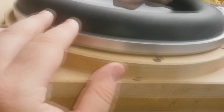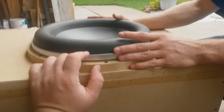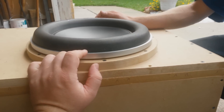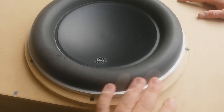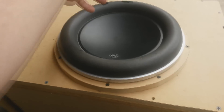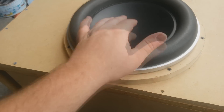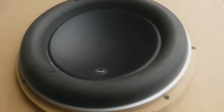It takes 12 screws to screw that thing down. For future reference, if anybody ever needs to know how to take apart a JL Audio subwoofer — you take this metal ring off by prying it apart with a screwdriver. There's a little gap right here that you pop off with a flathead. That takes the metal ring off. There's another ring that sits over the surround — you pull that off and the surround peels back. Don't worry, it's designed to do that, it's not going to hurt the woofer. It gives you a really nice fat surround and a really pretty design at the end.